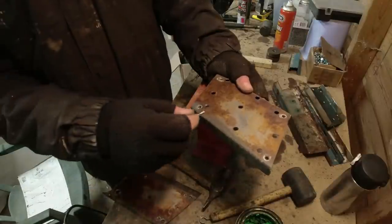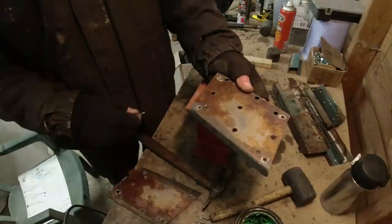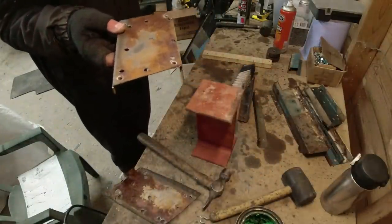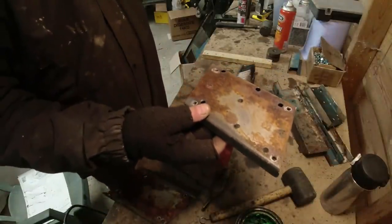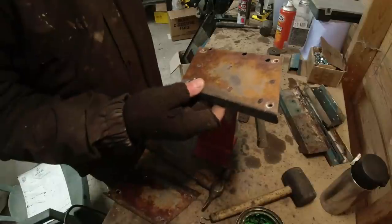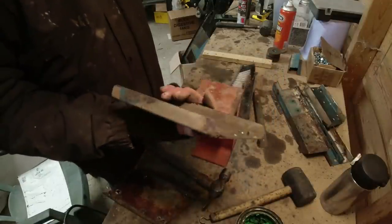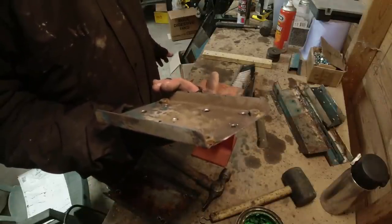when you're doing this sort of thing. You can see there is shiny bare steel, but there is just... And here it's rusted, the water's going between it. And this is how I find the insides of the doors when I rip a door apart. So whenever I see anyone selling me a rust-free door, there's a particularly amusing one at the moment. It's on eBay saying, no rust. And honestly, it's the rustiest door I've seen in ages. Maybe it meant rust is free.